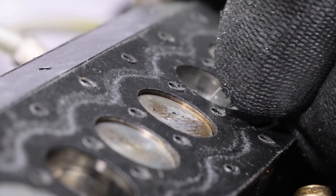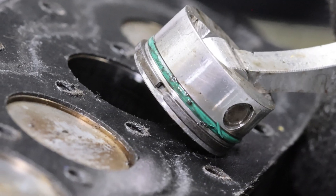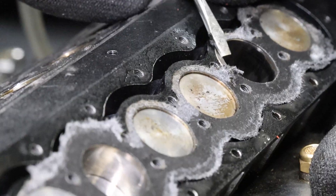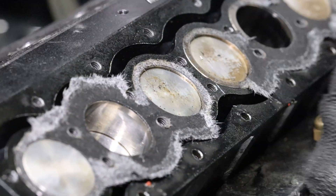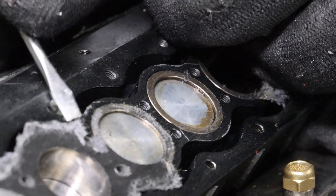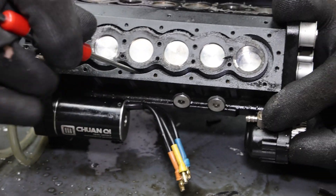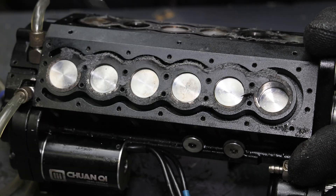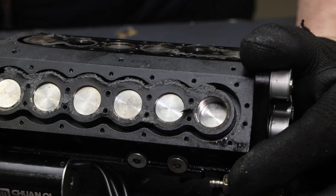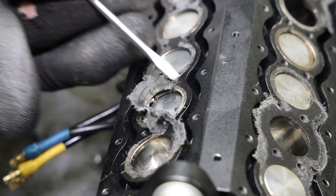The rubber ring is sealing, but that top piston ring isn't doing anything. You can see the only thing sealing this was that little bit of paper compressed right on that sleeve. Well, at least it's sleeved — the engine looks like it's built pretty well in that regard. Those water jackets — you see those grooves running through there — it's kind of like how the Supra does it with an open deck, but the water jacket is only going about a quarter of the depth of the cylinder. That would make a lot of sense as to why it was overheating, because if the water jacket is only cooling a quarter of the cylinder depth, only that little part was sealing the cylinder from the water jacket.